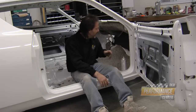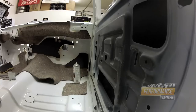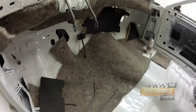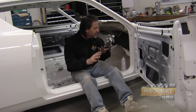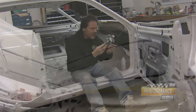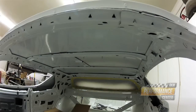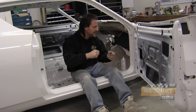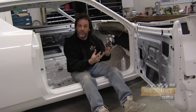I've also got the heater box completely torn apart. I've replaced all the felts on the flapper doors — everything that's gotten eaten up over time and deteriorated from varmint damage, where mice get in and make their little homes. Every piece of hardware that was rusted from rat damage gets sand blasted, bead blasted, refinished, cleared, and painted — whatever it was supposed to be.